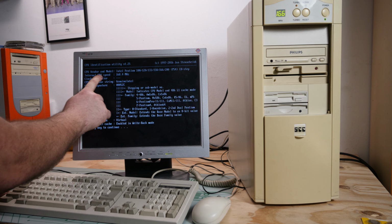So normally I put the CD-ROM player on top, and I'm not sure why I didn't do that in this machine, but I think it is fine as it is. The CD-ROM drive is from Philips, a nice Dutch brand. I think it's like a 20 speed or something, not sure. Here we have a 5.25 inch floppy drive, 1.2 megabyte. To be honest, it's in, but I almost never use it, but it looks cool. The only thing is I had to mount it like 3 millimeters to the rear, otherwise the door won't fit.